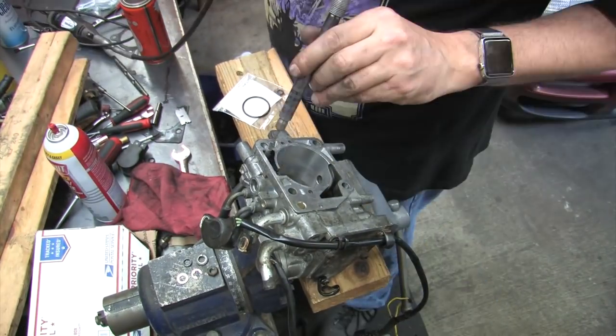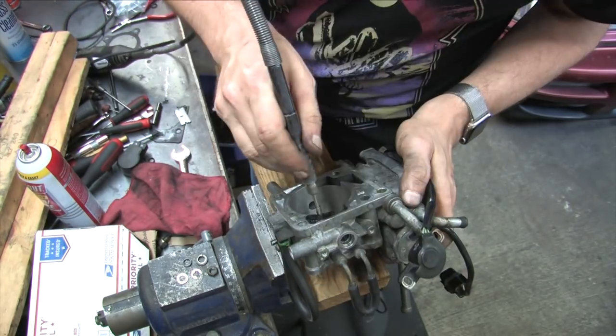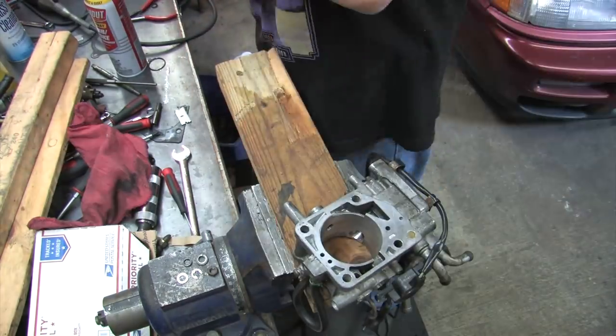Cleaning things is always a cure for negative energy, so I took it out on the throttle body systems with a wire cone brush on the Dremel. This makes quick work of breaking up the carbon and funk deep inside the cast passages, and the gooey stuff washes out pretty easily with some carb cleaner and compressed air.